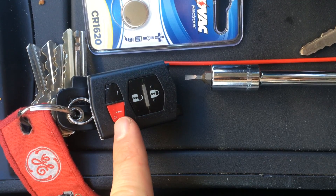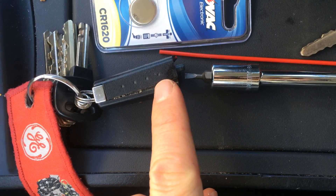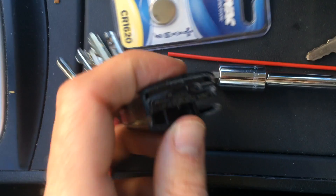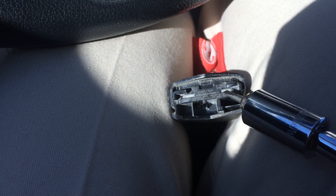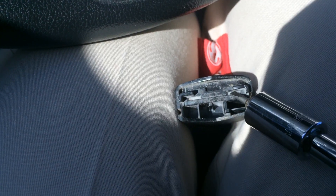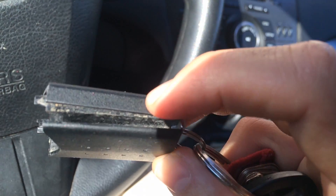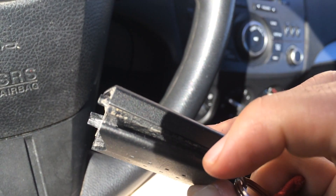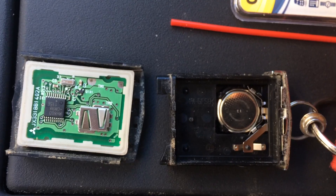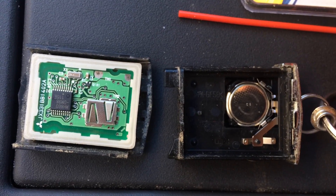Separate the top half of this part of the key fob from the bottom. I've pried the top off. The first thing that I did to separate this is to press two tabs. Tab one is right here, and tab two is right here, and you'll press until you hear a click on both of these two tabs. Once the tabs are complete, you can use a screwdriver and move down with a flathead until you pry off the entire top portion on both sides. Once complete, you'll have the top of your key fob with all the buttons on the left and the battery compartment on the right.